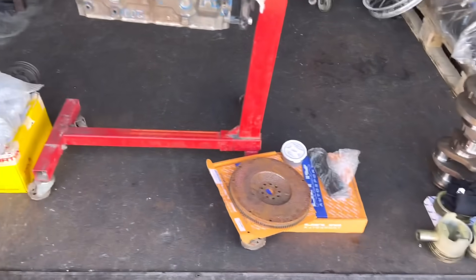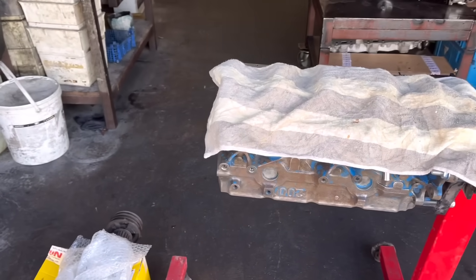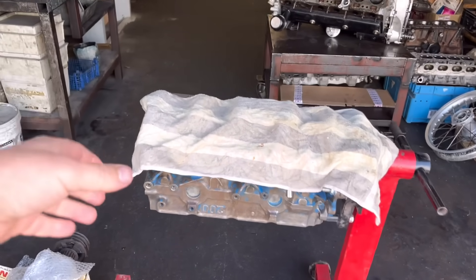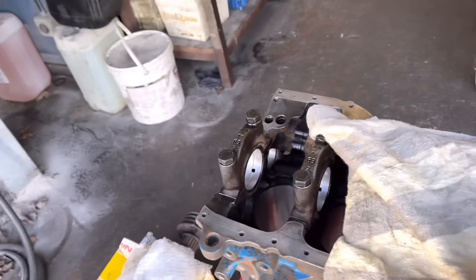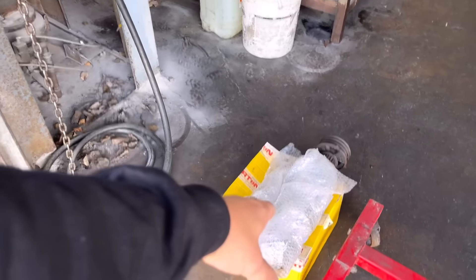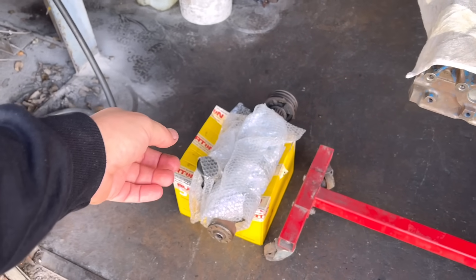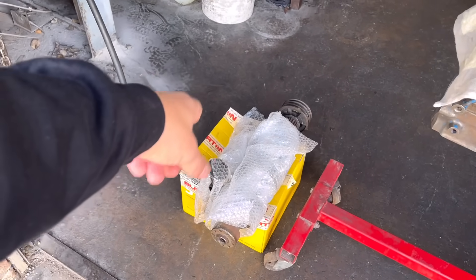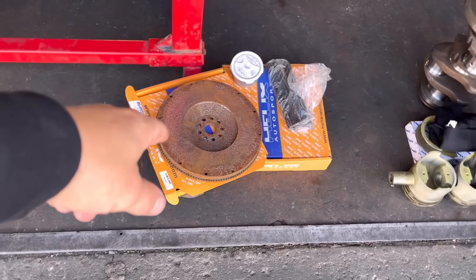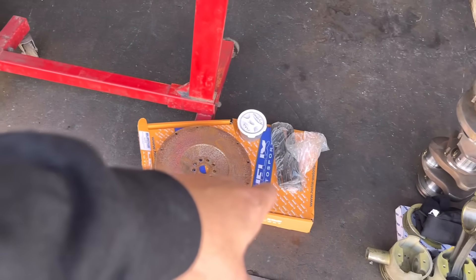One of the guys was to bring this one in. So this is another Cosworth, out of a four-wheel drive Sapphire. He's brought the bottom end in with new bearings already fitted, but we've obviously got to take them out. We've got to check all the housings, check the crank size, and if in doubt we've got to grind it. We'll obviously balance the crank assembly, check the oil pump - which may need renewing - and clean up and face the rusty old flywheel, then balance the crank assembly with a new Helix clutch.